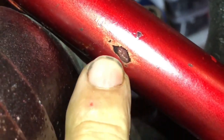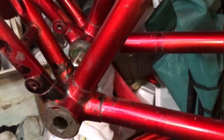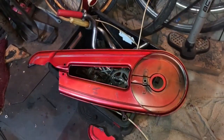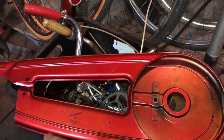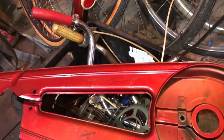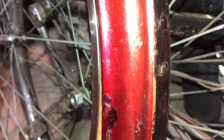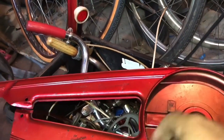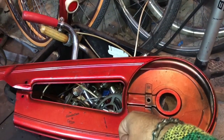Now that's an interesting point — I'm going to tell you about something. I've discovered the secret of why these Elizabethans fade to orange whereas the other carmine red bikes don't. For a better understanding, here's the chain case. It's always been the case that other carmine red bikes just fade to either a darker or just a red — more often darker because they're sprayed over the bonderizing black coat. So like this mudguard here, it fades down to a darker. Now the Elizabethan has always been a slightly brighter, sunnier-looking red, and then with age it's faded to this orange color — a distinct orange.